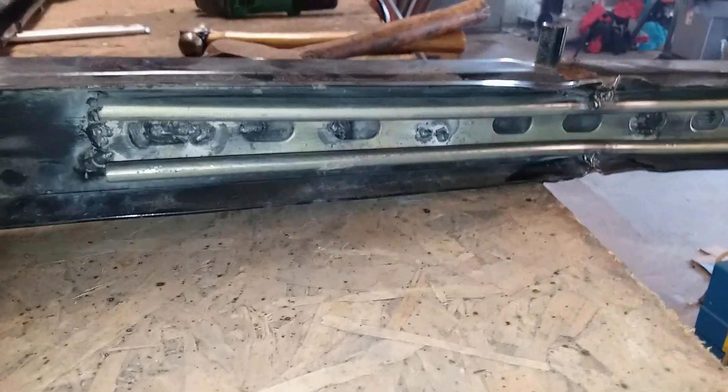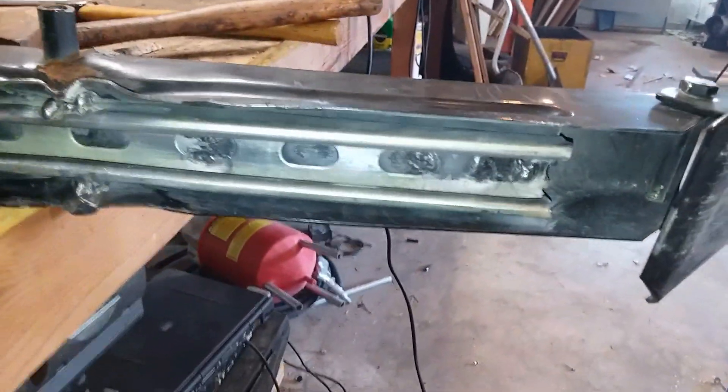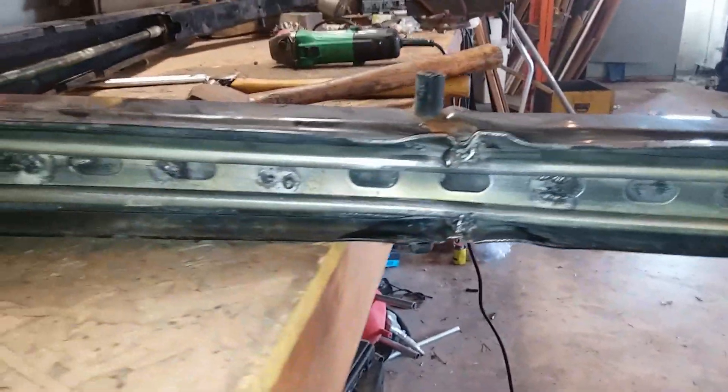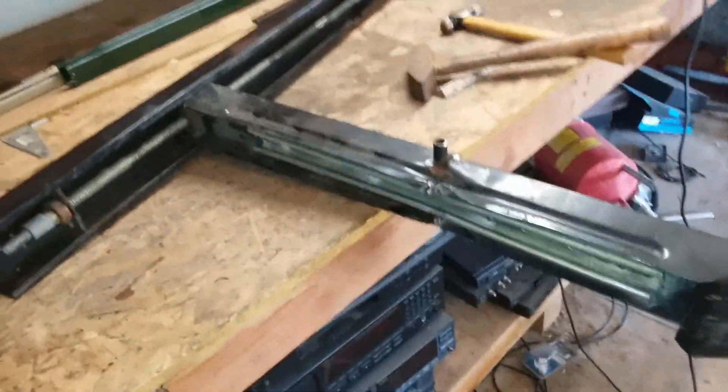A little more pounding, and I channeled the piece of unistrut into the parking channel. This is the part that comes up when it closes, so it's going to get in the way, but I think it'll strengthen it up. I got as many little spot welds as I could — my tip kept getting stuck in between here because this narrowed down when I pounded it in — but all in all I think this repair is going to hold.